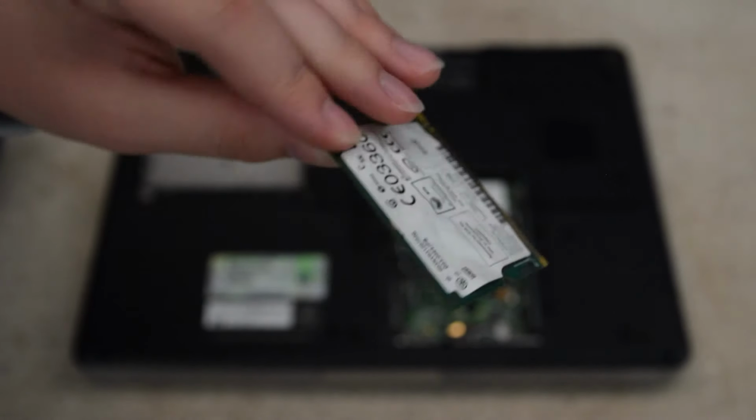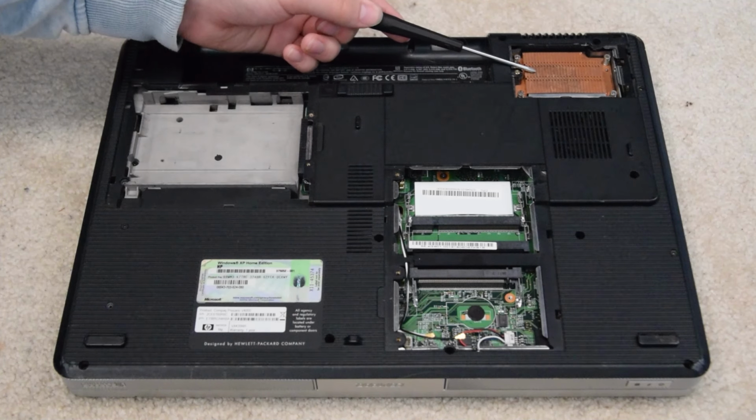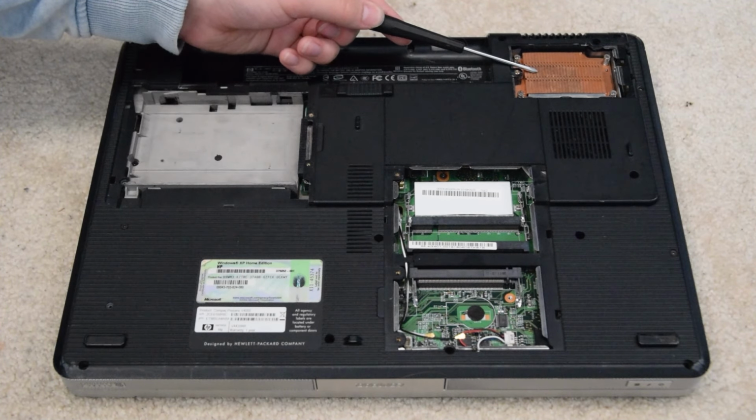And rather surprisingly for an HP product, you can actually get at the CPU heatsink without having to dismantle the whole device. Granted, it's being screwed down with a Torx screw, even though the rest of the laptop is Phillips screws, but I guess something is better than nothing. The heatsink on this thing is fairly small, but it's a fairly unexciting chip, so it's not really that surprising. And it means that you can repaste the CPU and clean out the dust without having to take apart the whole computer, so that is a plus.